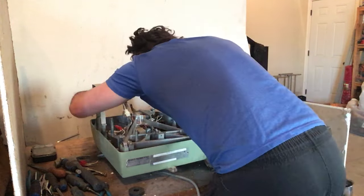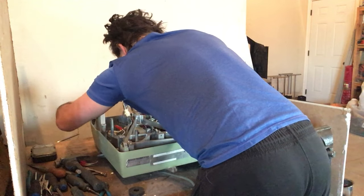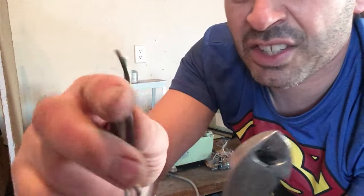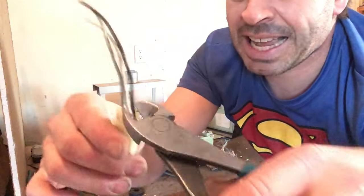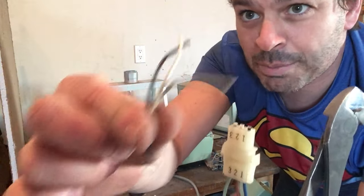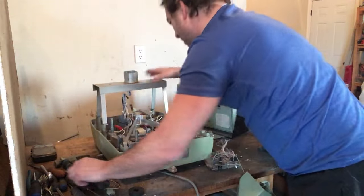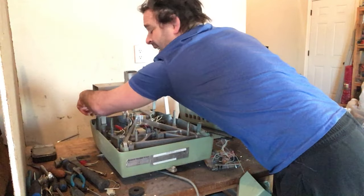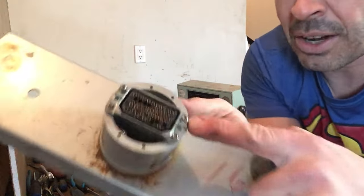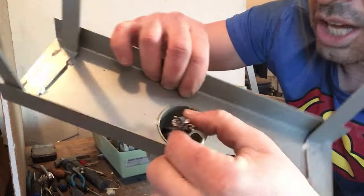Just going to quickly take the last one off here. There are a couple of different components in here, lots of wire and there is thicker wire that I see here. This stuff I can throw into my 60% - it is thicker, you can see the copper inside of there. But I do have to remove the plastic and brass plugins there to get that upgrade. So that will be in my 60%. This will be in my brass recovery - 19 cents. Scrap yards are getting more picky when they are looking at your appliance wire because of the difference in price. There is that brass there just screwed on there. I can remove it, but a lot of nice wire in there.